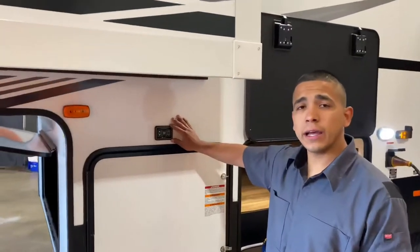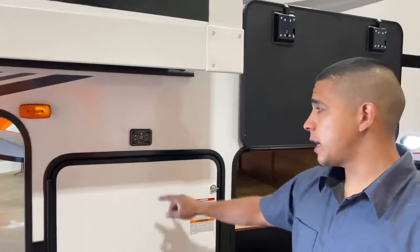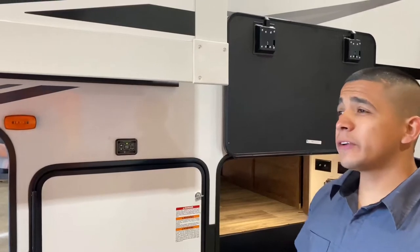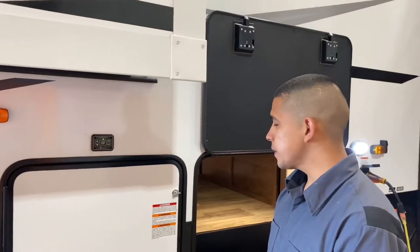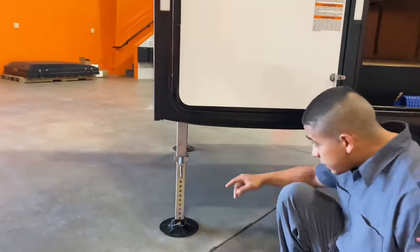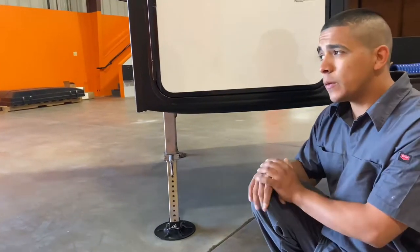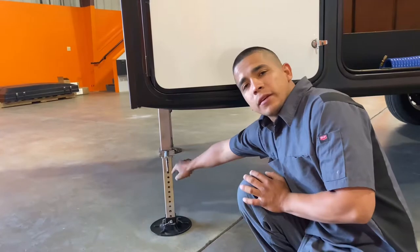To power this screen on, I have to push both arrows. Those arrows are going to control my front two legs — I can go up or down with the trailer. If you're in some sticky ground, make sure your steps are up before you start to auto level so you don't ruin anything at your door frame. You always want to start with your trailer a bit nose high; it always seems to work better that way.